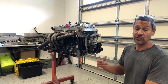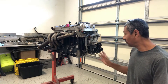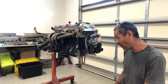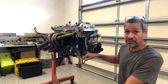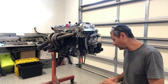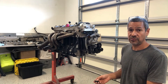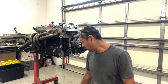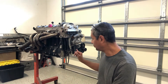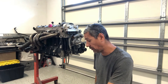They were trying to remove it. I've done a handful of these in a tight area like that. With it being so deep in there, some bits won't be long enough. So I had to be creative. One of the tools I had ready to use was a center punch — to get a little dimple in there so that my drill bit didn't wander around in there.